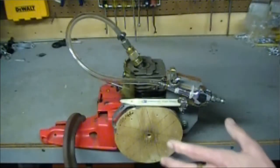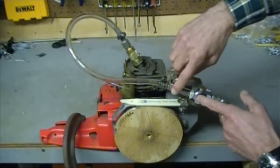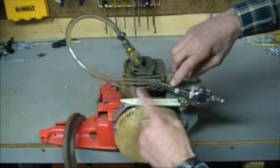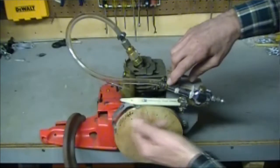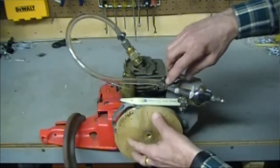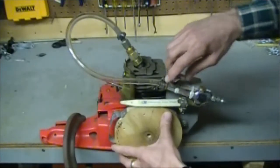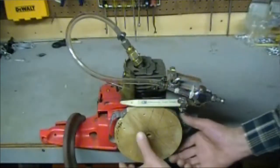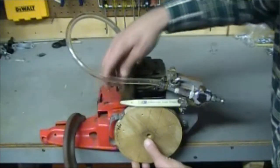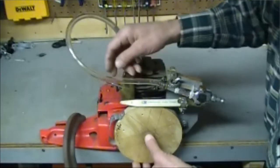What I've done is attach a blow gun — a simple hardware type blow gun — rigged up with a fiberglass windshield tool, actually for taking out windshields, something I've done in the past. Set it up with the trigger. This little flywheel here takes the place of a distributor in a car, where I can adjust and alter when air is applied to the cylinder.